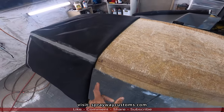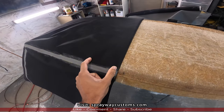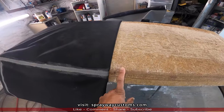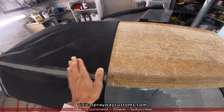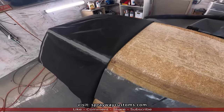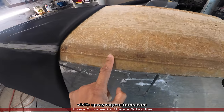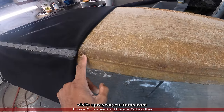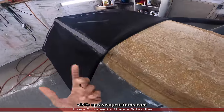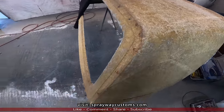in the middle. Then I put some on the fabric because it's contact cement, so you're gonna have to brush some on the shell, some on the fabric. Once it dry, you bond two pieces together. But I'm gonna do the middle first. See, I got my seam here lined up with this here. So once I do the middle, I'll be able to stretch it somewhat, because this canvas, it don't stretch like vinyl. So I'm gonna try to stretch it, put it in place.